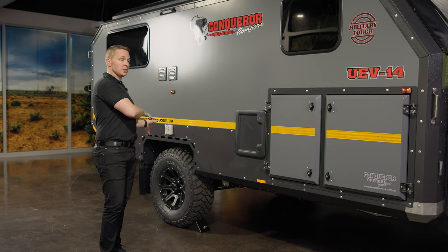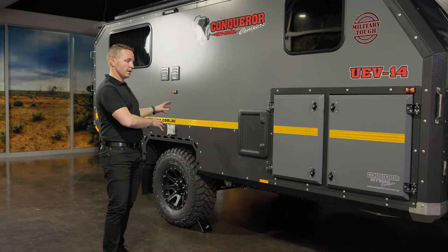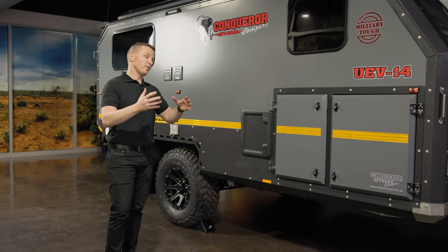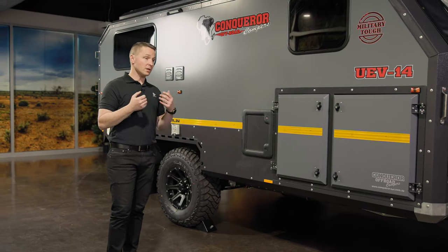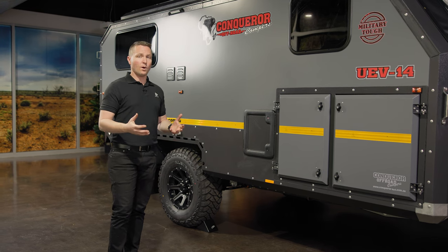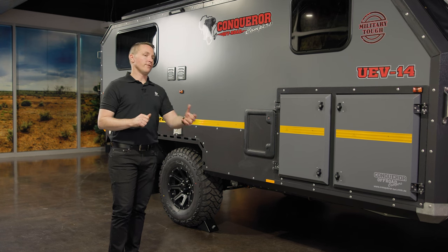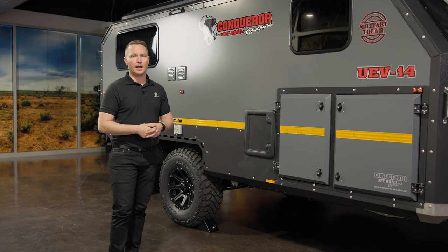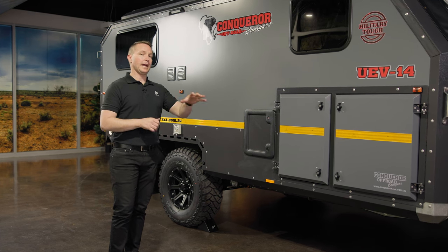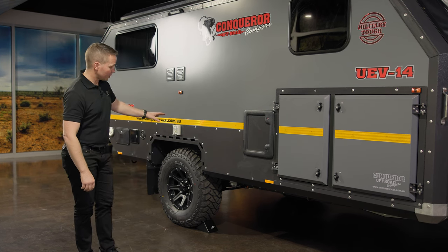If you rupture your 120, you've got your 80. If you rupture your 80, you've got your 120. When I go off-road, if I don't need 200 litres of water — it's 200 kilos and a lot of weight — if I'm going away for a weekend I might put 50 litres in one and 50 litres in the other, riding with 100 litres balanced 50-50. It's really good underbody protection.